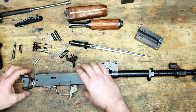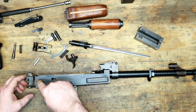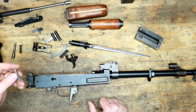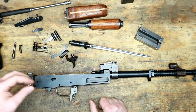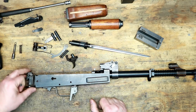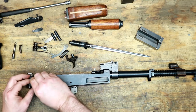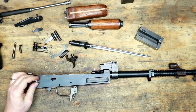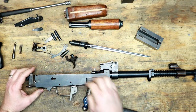All right, let's put the knuckle in, I guess. I'd welded the original hole up in that knuckle. That way, I used solid carbide to drill through it, since the weld's a lot tougher. That way, the hole that I drill is all going to match up perfectly, because the hole that was in this knuckle back here was kind of sloppy. It was oval. And so I figured in order to tighten everything up, I'll just go ahead and fill that hole up in the knuckle. Be done with it.